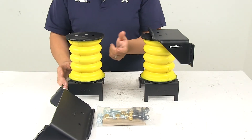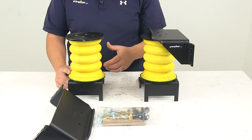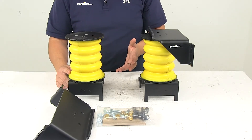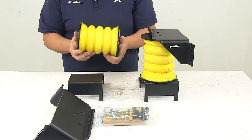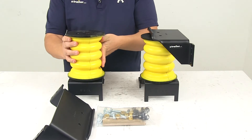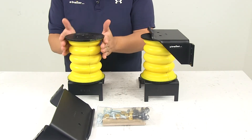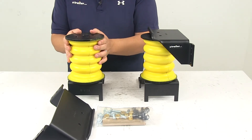Overall, nice design and really durable construction. We're looking at high density microcellular urethane, designed to work in extreme temperatures anywhere from negative 25 degrees Fahrenheit to positive 200 degrees Fahrenheit. The material is designed to resist damage typically caused by oils, road salts, and UV rays. They also feature minimal lateral expansion, so these springs compress vertically instead of off to the sides, meaning they aren't easily damaged when operating in tight spaces.